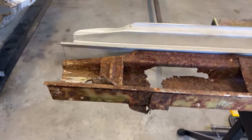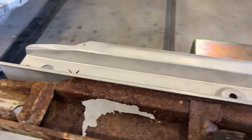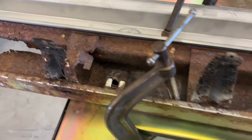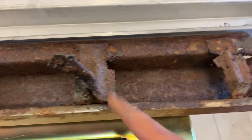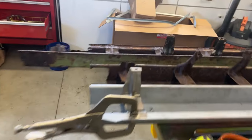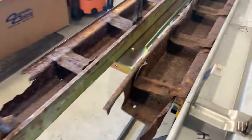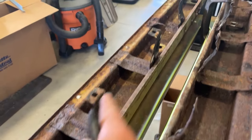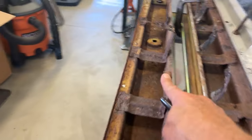I'm going to remove that right side rocker, passenger side, lay it upside down, and match it to this one as far as the location. Then I'm going to mock where these stock side molding mounts were, so I can get those welded onto this unit. What's difficult is some of these old ones have been bent out of the way, so I've taken a couple of them and straightened them as much as I could to simulate the original.